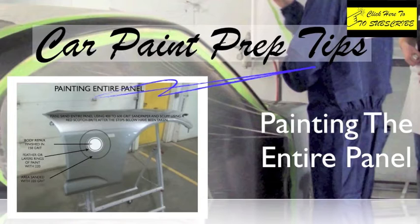You can also use a DA sander, a dual action sander, to do your final sanding. 500 works real well for that. It is a finer grit, but it works so much faster. It's going to take a lot less effort than the wet sanding by hand. So we're going to go ahead and sand that entire fender. Then we can do our priming, our blocking, and then it'll be ready for paint.